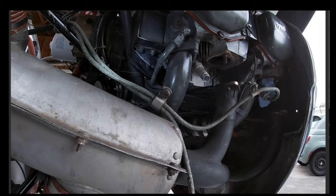Now, here's another image of my engine compartment on the right side, on the passenger side. And that bar that goes underneath there, you could just barely see it here. If you take the front cowling off, really one of the only things that's holding that front cowling on there is the rest of the cowling and this little ditty right here, this little bar. So you just go in there and take that bar off. I believe it connects to something on the cowling up here. I'm not quite sure. Maybe no, I don't think it's the cowling. I think it's actually the baffling. The baffling is being held by this little bar right there, and then the cowling is held on by the rest of the cowling. So there's really nothing holding the cowling on except the rest of the cowling, like the top flaps and the underneath part that goes on the bottom. So my suggestion is just take all of that off so that the baffling is not in your way.